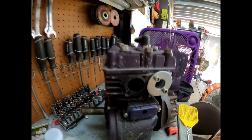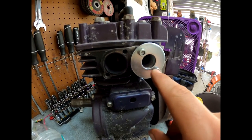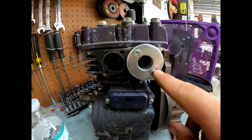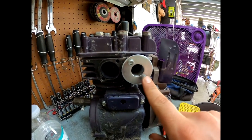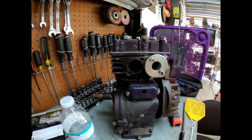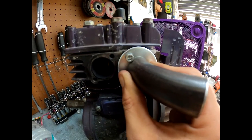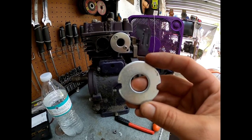I actually had to take these bolts out that I originally had in here — I totally forgot about this. These bolts aren't going to work because there's just not enough room for you to spin that bolt. So what I got here is some Allen wrenches and I'm going to send these with the intake so Saul has a way to get it on his motor. These are just quarter-twenties, standard coarse thread, about half inch long. He's got bolts now. After kinking it, it fits perfectly. So what I'm going to do now is take my washer and bolt this to my carburetor.